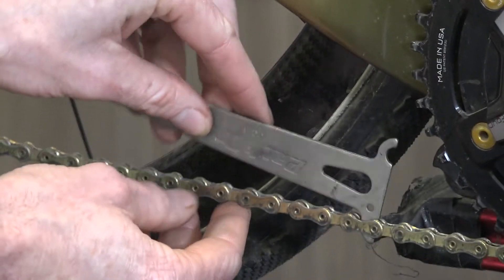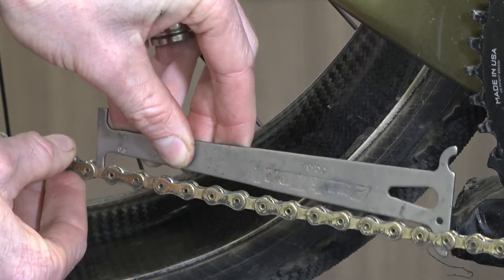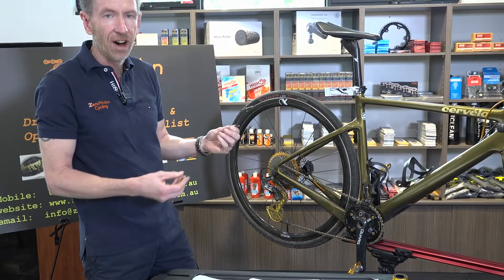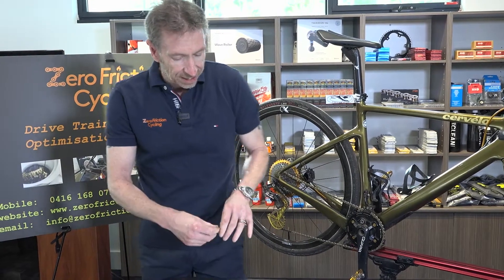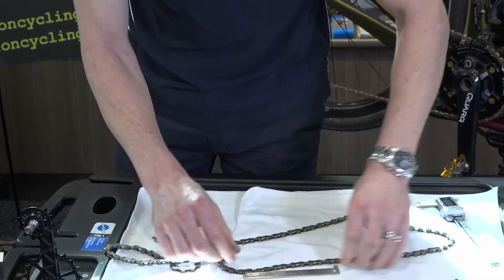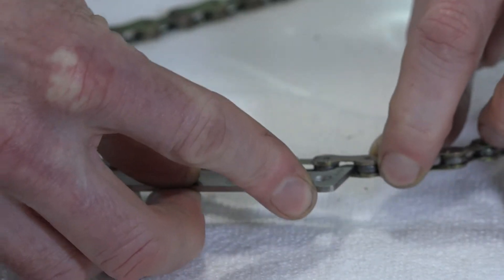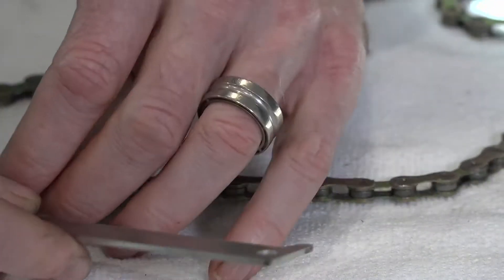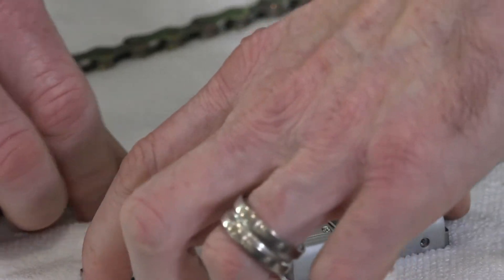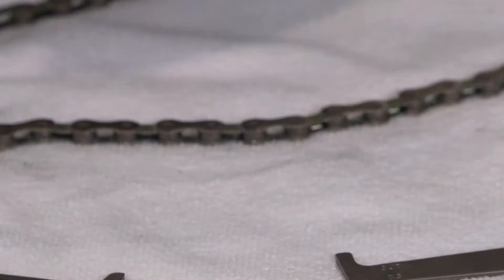Using a little bit of force, my chain wear checker gives a 0.5 reading equivalent to 0.41 on the digital gauge — I'm actually happy with that because it errs slightly early rather than late. By comparison, with a different brand checker on the same span, I can't get it to go in even pushing pretty hard. That brand's 0.5 mark would let the chain go past where it should be replaced. On a chain that's still in great shape, the tip of the Shimano tool catches a lot of roller — there's absolutely no way it goes in. The digital checker confirms 0.01%, basically measuring as brand new.